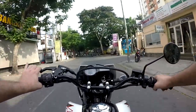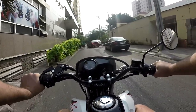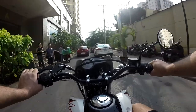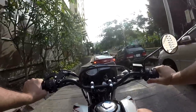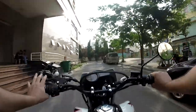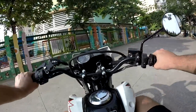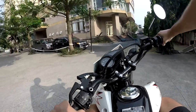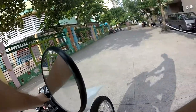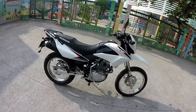The last point I want to talk about is gears: gear one is for accelerating with a low top speed, gear five is high top speed with low acceleration. What we sometimes find is people driving around in gear five too slowly — you can hear the bike really struggling in that gear, and people drive them up hills like this. It doesn't matter how good the motorbike is — if you do that, it is going to break. If you've never driven a manual motorbike, consider whether the concept of gears makes sense to you, because if you're not naturally gifted with vehicles, maybe the semi-automatic is better, where you can have gears but no clutch.